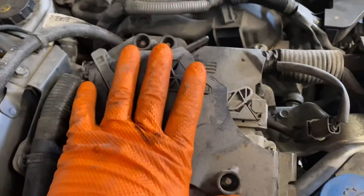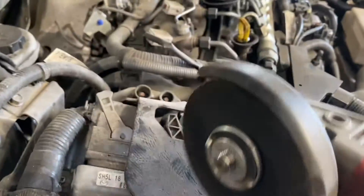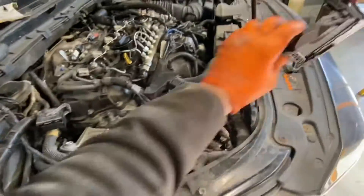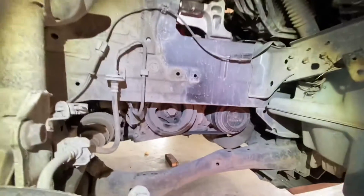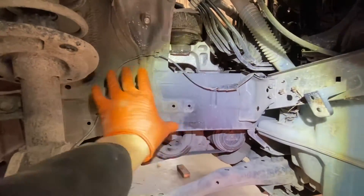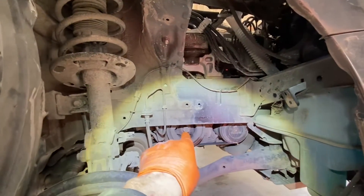I'm just going to pull off this engine ECU. A little fast tip: I run across these things with an angle grinder, a little stainless steel disc, and I go straight down through it. Unplugging a couple of bits and pieces, a few little bolts - easy enough. I've also pulled back the wing liner a bit to get a bit more access. It's a relatively nice design - we have only nearly the chassis leg in our way. I'll take off the belt and crank pulley here and then roll on up to the top for the rocker cover.